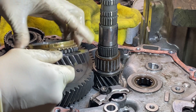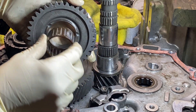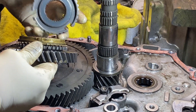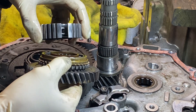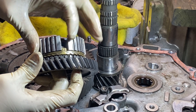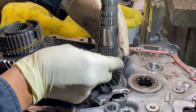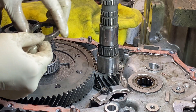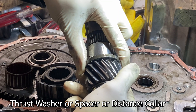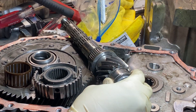This is first gear. And here is a needle roller bearing - that kind of fits together like that. It's important to note that the little brass protrusions right here have to sit in there - see how it sits in there. The little protrusion fits into the little hole right there. And don't forget about this little spacer down here - there's a little spacer that goes down at the bottom. One of the things I forgot to point out was underneath this thrust washer there is a ball - see the spherical ball right there. Be careful with that thing so you don't lose it. Grab it with a magnet and put it in the bag with the other stuff.